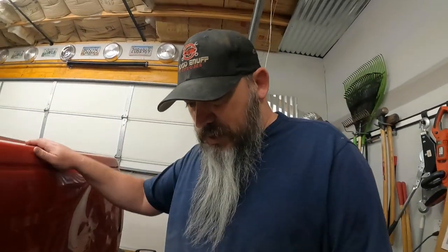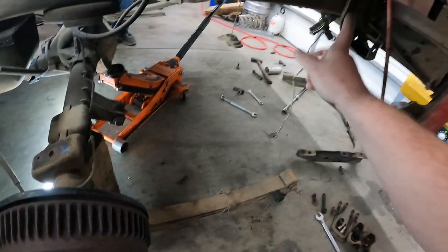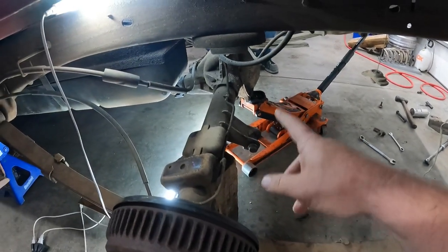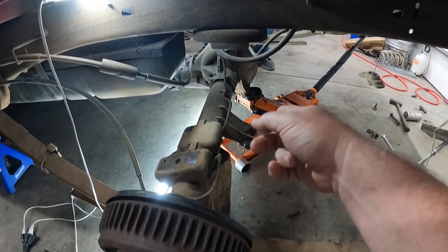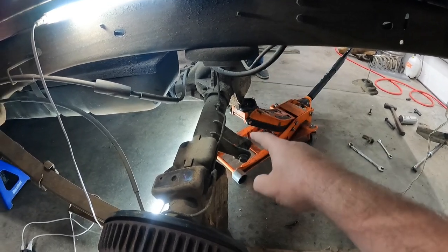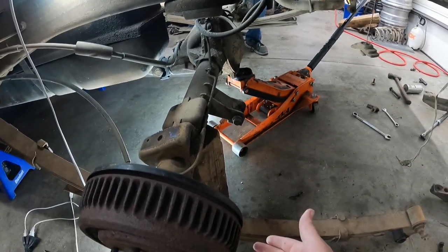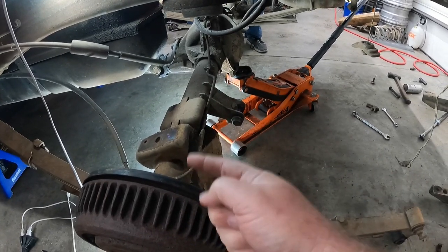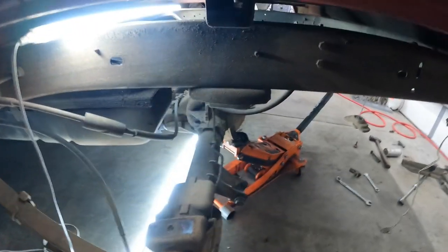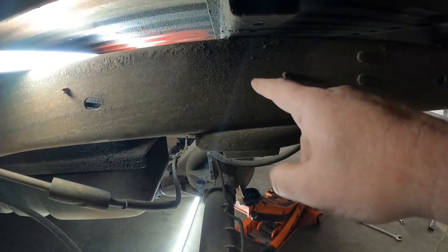Next day — well rested and ready to tackle the rest of the suspension. Where we left off, we got the axle actually on top of the leaf springs. Now we just have to get the leaf springs back up into the hangers. We'll jack up the rear end, but we'll probably have to reposition the jack first. Once the springs are in the hangers, we can set the rear end down on the flip kit cups and get everything loosely bolted together so we can line up our centerline for the C-notch.